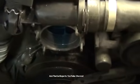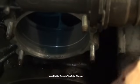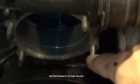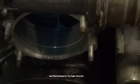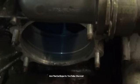Now, if you did snap off one of those nuts, you would have to try to replace the studs here. They might come out if you double nutted them and then backed off the back nut to try to walk that stud out. But if you have a lot of corrosion already, you might be drilling this out, and any kind of mistake is going to cause some damage. So you're better off taking the time to spray some penetrating fluid on the four studs, on the four nuts, and let it soak for 10 to 20 minutes. Try to break them free, use a little bit of heat on those two again, and then usually you can break them free. Too much rust, think about replacing those 10 millimeter nuts.